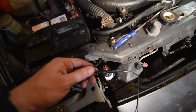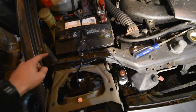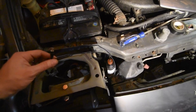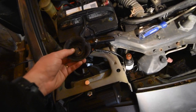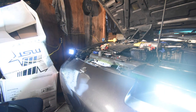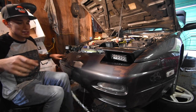Basically you've got two wires — power and ground. I extended the ground and run it behind this tray, this little plastic piece, and then bolt it to one of these chassis bolts — whatever is clean and available. Your power wire runs to the bottom of the three pins on your OEM plug. That bottom connector is where your constant power or signal comes on when you flip your headlight switch. Holy bright — it works!